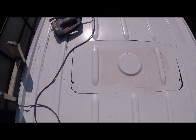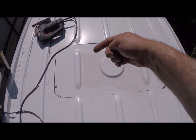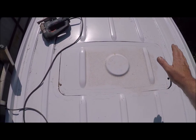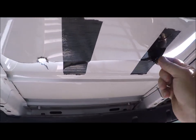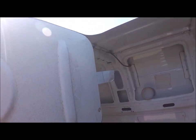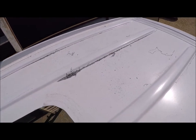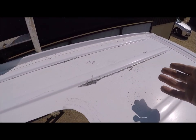That stage is done — it's all cut out. The reason it didn't drop through is because I taped duct tape underneath to support it so it didn't sag while I was cutting. Hello sunshine! We're making progress. And don't forget to hoover up all the metal filings because they turn quickly into rust.